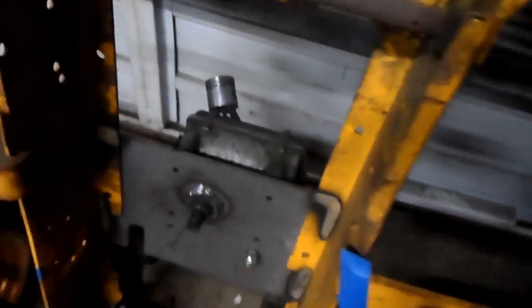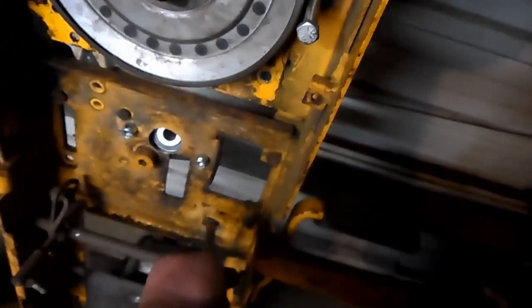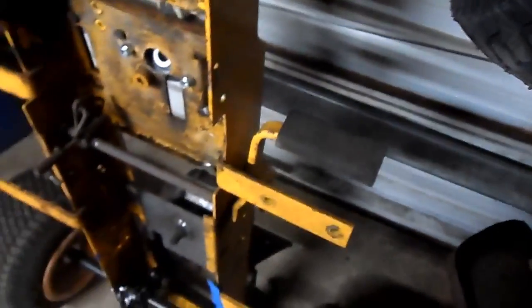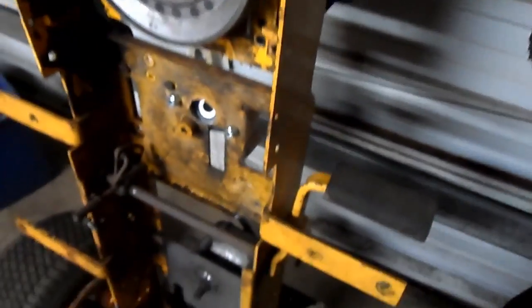And then on the transmission pan, when I get the transmission pulley, I'll do the same thing. Clean this up and do the exact same thing I did up here. What I have left is I got to add a clutch within here, and relocate this foot clutch probably a little bit farther towards the front of the mower, because I'm pretty tall. Move that, put an all new rod, and I got all new steel to make a new rod, Heim joint and all that.